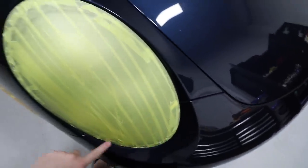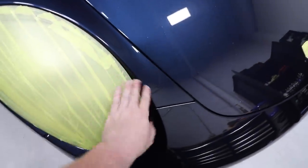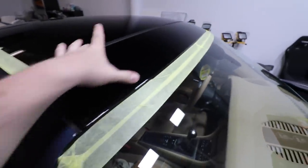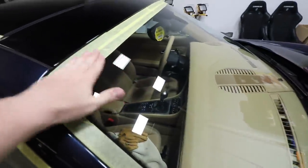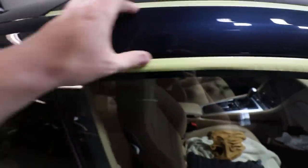Most people usually just tape off the outer rim, but on Porsches — especially 911s — the way the headlights are shaped, your pad is pretty much going to be hitting a lot of that, so just to be safe I like to tape it all off. You've got the side markers taped off as well, part of the side mirror arm, down here against the door, and part of the windshield. This area is piano black so it will get polished, and this is glass so we tape across here. The A-pillar is blocked off so you're not polishing into the glass. And all this chrome here is taped off specifically for working in these tight areas — I'm going to be using a smaller machine with a three-inch pad but you'll still have that overlapping pattern.